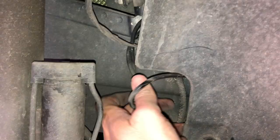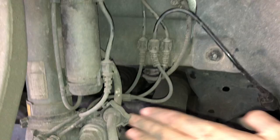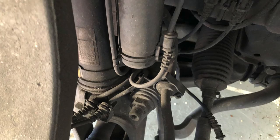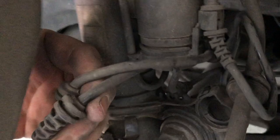As you can see, we've been able to pull that electrical cable through without removing the inner skin. What we're going to do next is unclip all of the electrical connections that come down onto the air strut. I recommend you stop right now and take a couple of photographs so you know how to get this all back together at the end. We've got all of the electrical connections unclipped free of the strut, and we've also unclipped the brake line so we're going to be able to get this strut out.